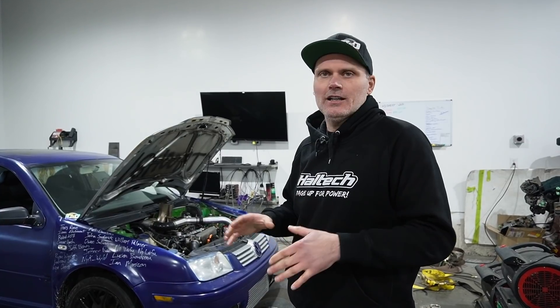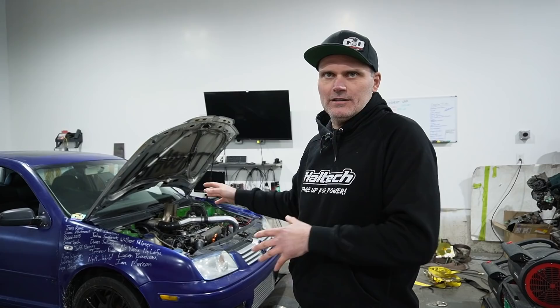It's going to be — there's parts on it we need for other cars. But the main reason, even if this was summertime and we were doing this same thing, the stock O2J transmission in these cars is not up to the task, nor are the axles, for drag racing at this kind of power level in this heavy of a car.